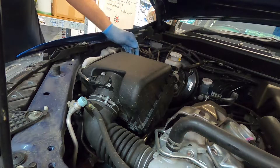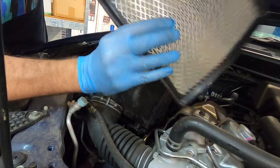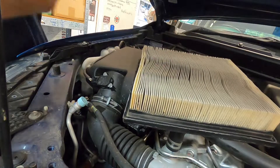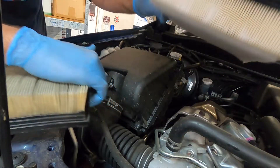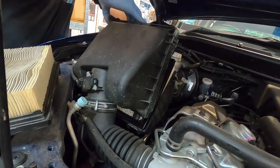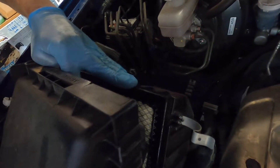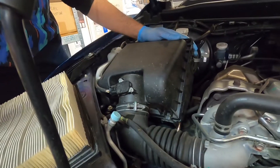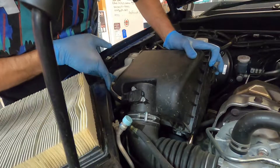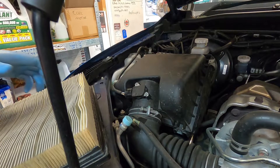Now the air filter - the air filter box has two clips on top, pop them off, pull the top of the box towards you and out comes your old air filter. You can see it's pretty dirty - at that point I wouldn't even bother blowing it out, just put it straight in the bin and put a new one in. Here's the new air filter - this one's got an extra protector over the front. It sits in the same way you pulled it out, push it down, gauze facing upwards sitting fairly tight. The seal is what seals it to your box. Push the hose making sure the lower tabs go first, squeeze the top down, push it on and done.